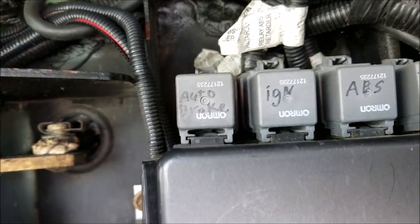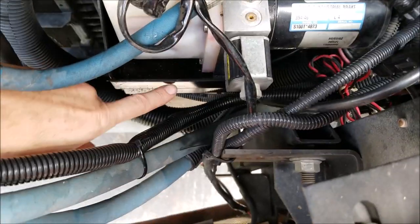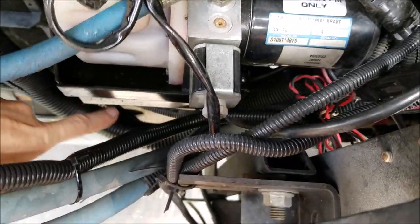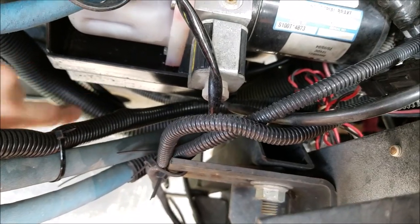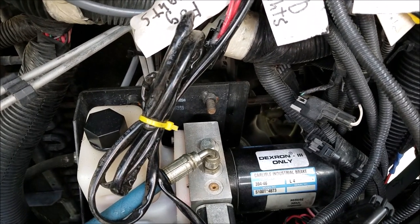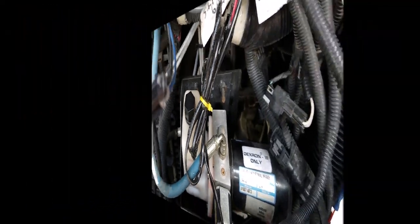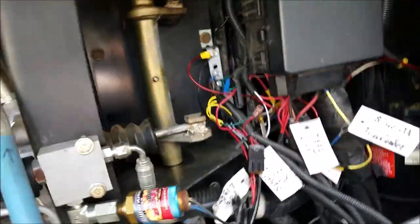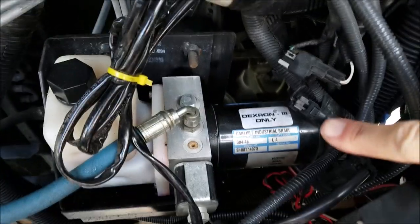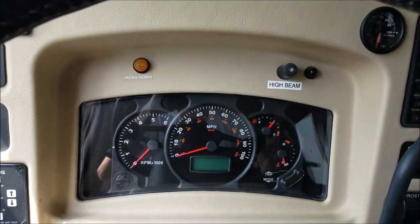Your pump could also fail. Underneath the pump there's a little computer box put on by Workhorse that monitors all the inputs. If you haven't done the upgrade to the Brazel's Ultra Stop, that computer could fail and leave you stranded too. Several different failure points. I've been thinking how I can get myself out of a pickle, and I think I've come up with a solution. To demonstrate: here's the relay — I've already unplugged it. Without this relay the pump won't energize, so you won't get 1,500 psi to drive away.